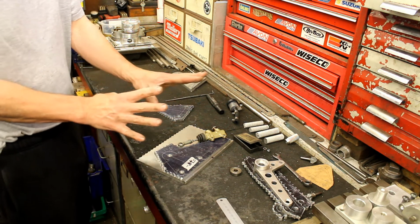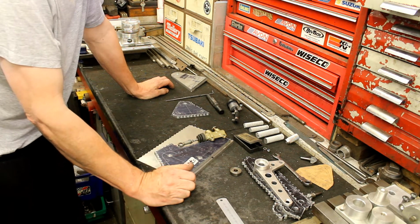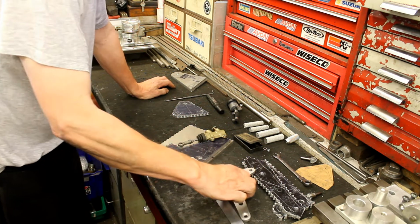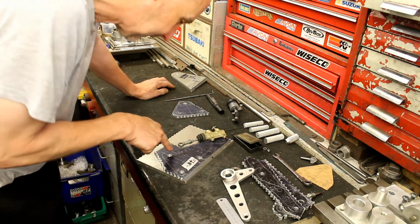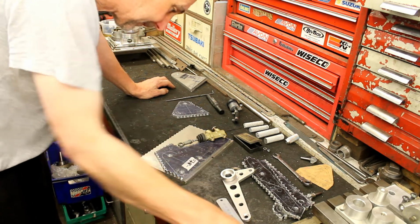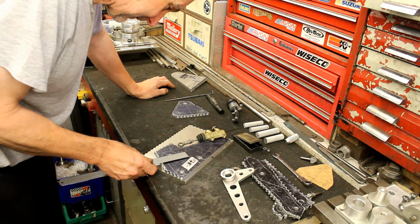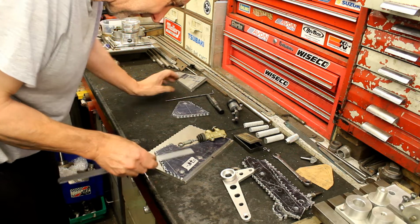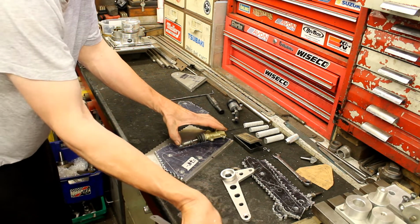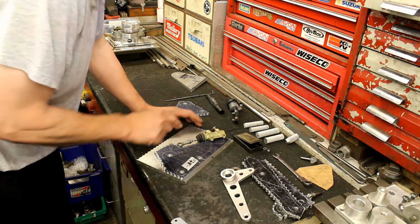Aren't we having a flat 180 degree brake pedal on there? Are we not? You made a start on one there. Is that the pivot? Is that line there, or is it that one? It's 40mm from there anyway, whichever one it is, from centre to centre. About 40mm. That looks about as though it's in the middle, well, just below that. So that's virtually not far off in the right spot. You could lose a quarter inch, half inch off that. Yeah, no problem.